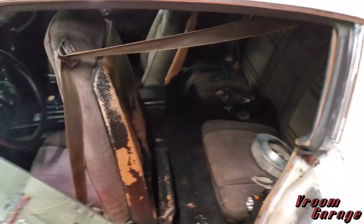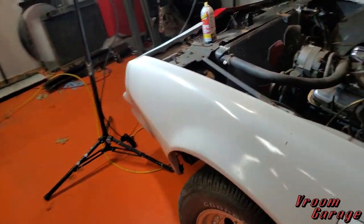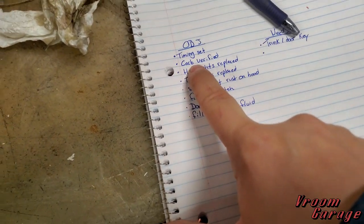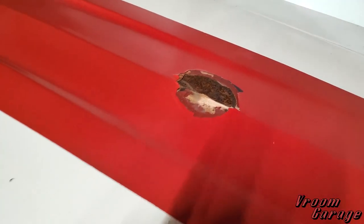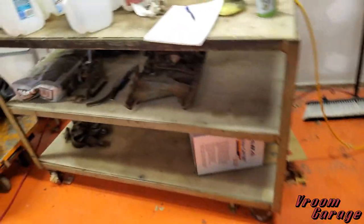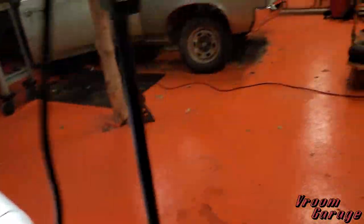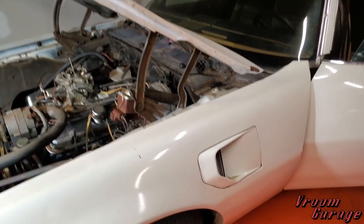The interior is actually not terrible — needs to be cleaned, re-dyed, and painted, but that's stuff that's nearly free to do. Going through my checklist: I need to make sure the timing's set, verify the carb is actually opening like it should. No headlights, no taillights right now. There's a rough spot on the hood where it backfired, so something got a little toasty in there — I've got to clean that off, paint and seal it. Hood latch sticks, which is very common for cars that have sat, so I've got that soaking with silicone spray.